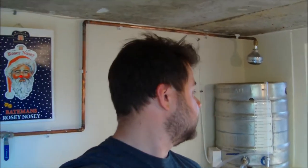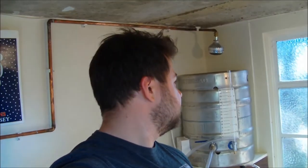Stupidly, instead of just letting it cool down, I opened up the water and it just hit the red hot element — hissed and what not, knocked all the power off in here. Now every time I turn the element on, it knocks the power off. Cold water hitting the red hot element — I think it's cracked it and broke it, and now when you turn it on it's shorting.